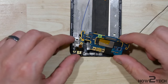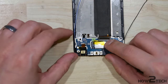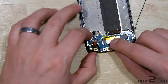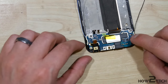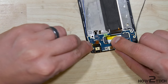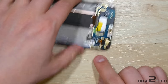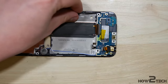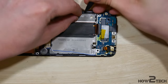Now we can go ahead and take our charge port and stick it back in as well. You may have to wiggle this back into place a little bit. You want to make sure there are no connectors underneath it — the home button cable, the 3.5mm headphone jack, all of those cables are on the front side or top side of the board, nothing underneath. Make sure the wire cables are in their guide slot area. The little clip right here you want to make sure is pushed in, and a clip up on the back side of the board, right below the battery. Push this into its slot so it doesn't get caught underneath the board when we put the screws in — we don't want this pinched at all.